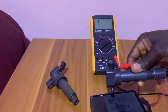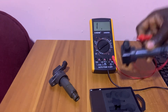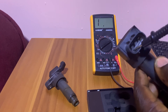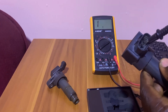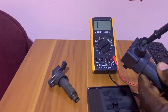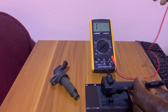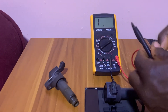We are also going to test the three-pin ignition coil. This coil is good. What we normally do: the left pin is the negative, the middle pin is the trigger wire which comes from the ECU, and the right pin — the first pin — comes from the power supply, which is the positive. So we are going to test the ohms and resistance.